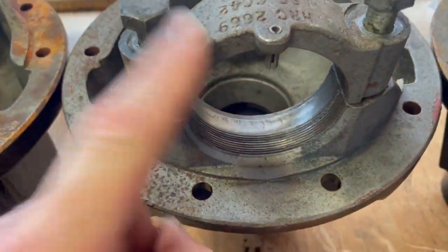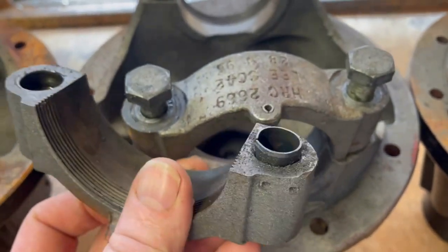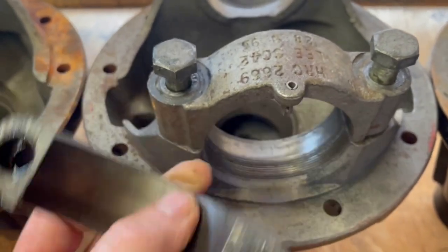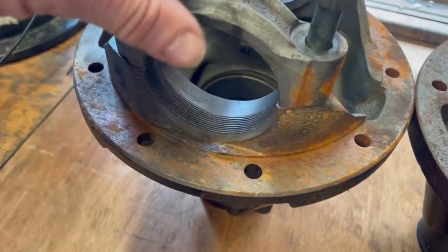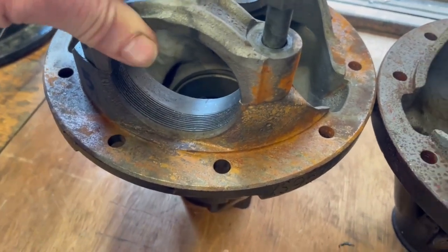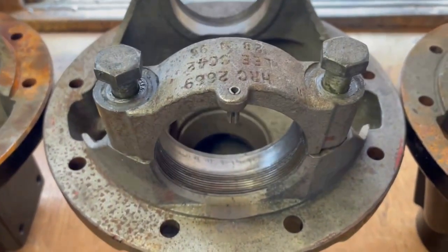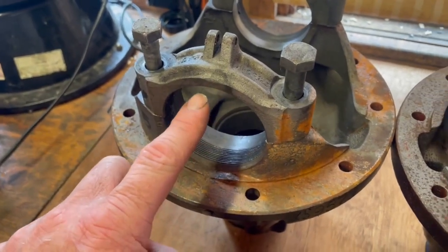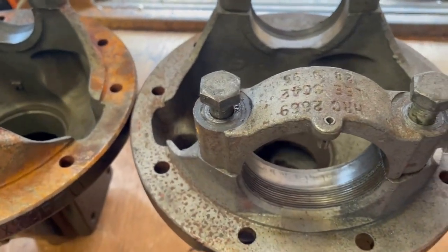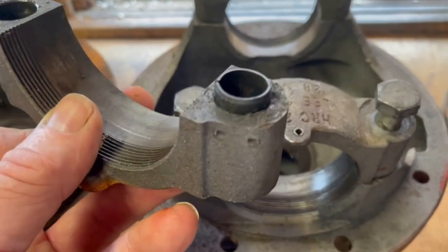One of the good things about these casings is Land Rover came up with a collar that locks in — this is off one of these diffs. These collars lock into a similar hole at the bottom here and stop shuffling. Shuffling is where it can move around; these don't because they're locked in, so that's actually an improvement. Our problem was to get rid of the roll pin weakness, and we finally came up with an answer which allows us to use these locking ears on these types of diffs, which also have these locking collars on the other side.